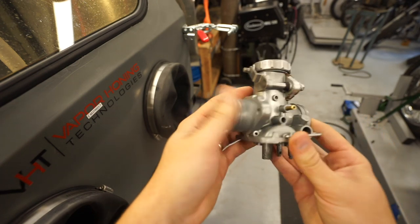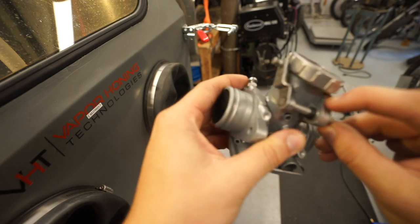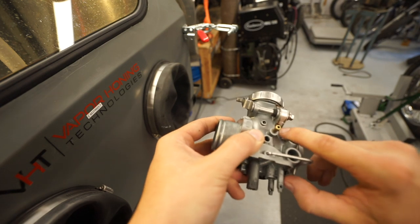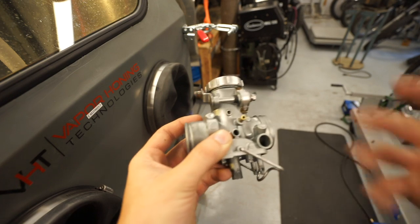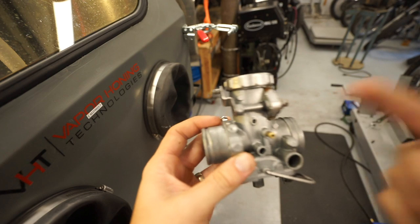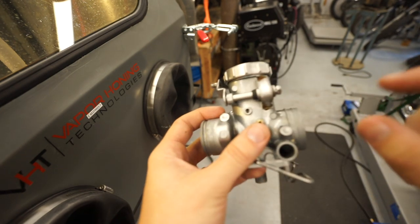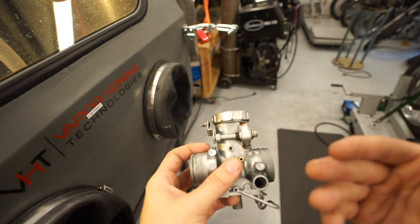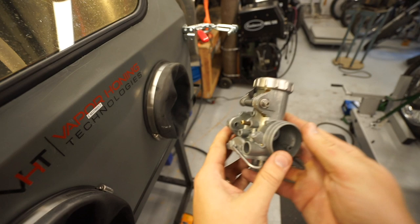You can see the body — short of the little heavily corroded and rusted area in the corners that you might have to hit with something more aggressive or by hand — the beauty of this machine is because it is so gentle, it's actually safe on rubber, on brass, on aluminum, and even on plastics. So if you have a plastic choke lever on your carb, you can blast right on that and it will clean the plastic up without tearing it away. There's no way you're doing that with a dry blasting cabinet.